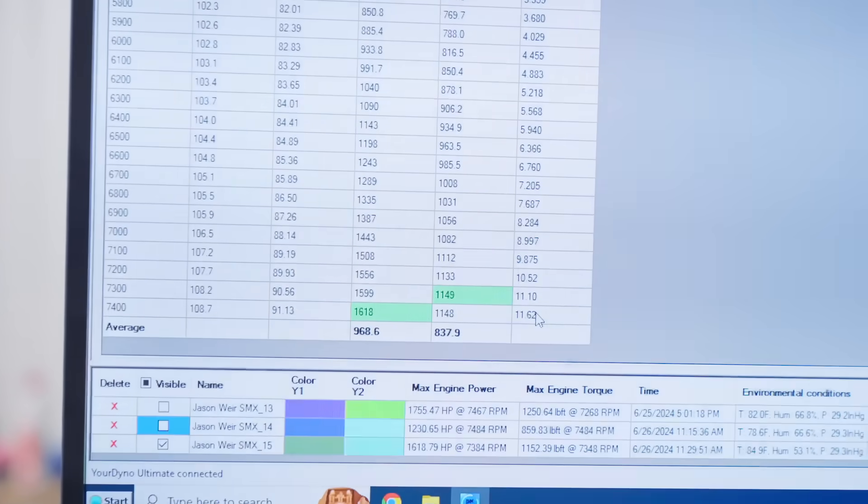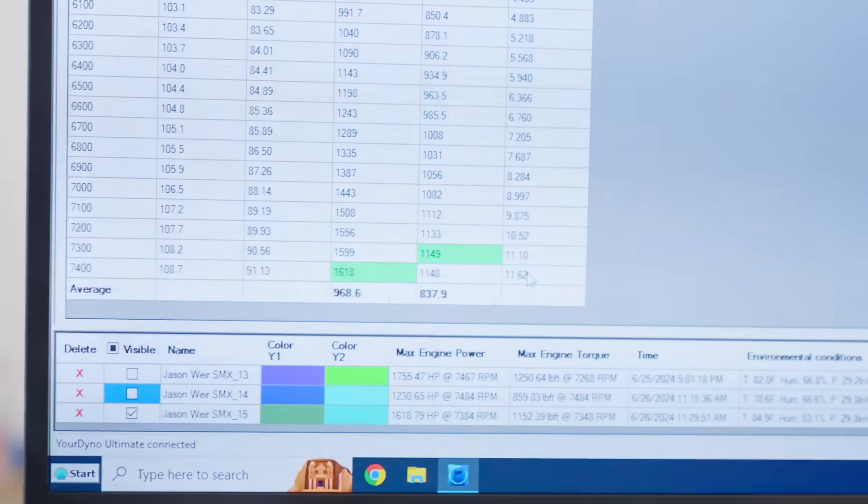Learned stuff, interesting things. Never done that before. Now it's — oh — and also, you can't do this on a centrifugal supercharger. No, you can't do it over there on that big F4R 140 — or I'm sorry, F4R 140, 144. What happens is, this is a turbo, you overspeed the turbo. You can't overspeed a supercharger. What are you doing with a supercharger? You're allowing maximum amount of air movement to go through it, which drives your parasitic drive loss astronomically high. It loads the blower so hard — yes, it would lower the boost, yes it would probably control it to a certain extent — but it adds so much drive pressure to the blower they'll tend to break the blower. Don't want to break the blower in that case.